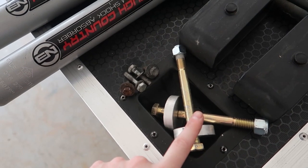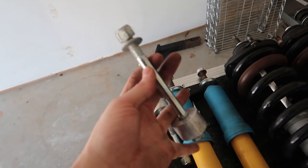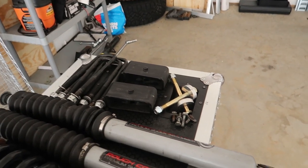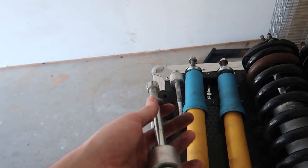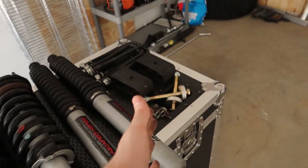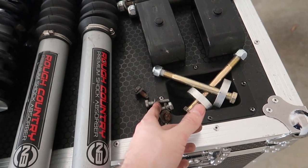My Tacoma's four-wheel drive so my CV angles were on the high end and I could tell it was struggling. About 5,000 miles into running this lift kit I went ahead and bought a bigger diff drop kit. This is a solid one-inch drop kit versus the half-inch that comes in the kit — double the actual drop. This helped a lot with the drivability; it sounded and felt a lot healthier while driving.